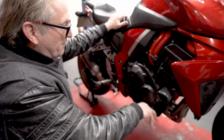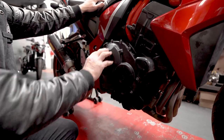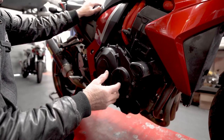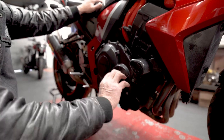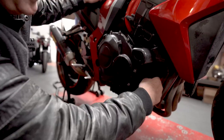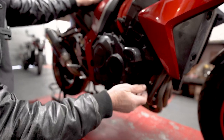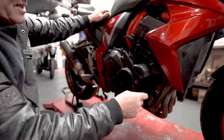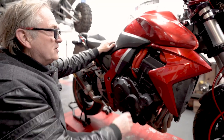So we've got to take this cover off, this out, put some stronger clutch springs in, put the spigot drive off the end of the crank outer here, and then put our bearing assembly on here so that we can assemble the supercharger. And the air intake goes behind the exhaust and out the other side with a filter, so we've got plenty of ground clearance, not going to affect his ground clearance. Belt drive here, nice little belt guard, and the job's done.